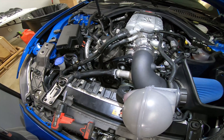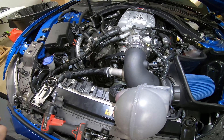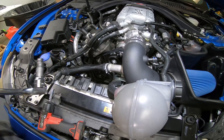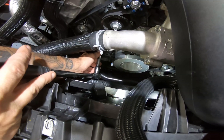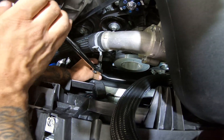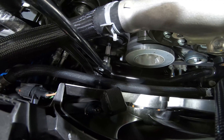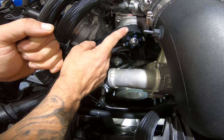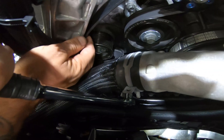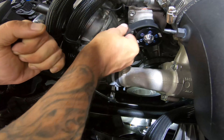Now I'm going to show you how to get the belt off this pulley first, because in the case where you might want to change the pulley but you don't need to change the belt, this is what you would do — you don't need to do the front one. We'll circle back to the front one in a second. Install the half inch into the Whipple tensioner and go in this direction. In this case, this belt's really tight, so instead of pulling it off the supercharger here, you can pull it off the ribbed idler — that'll be easier. One or the other should work fine, and then we'll take it off the supercharger.